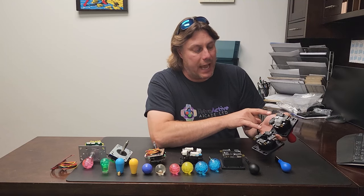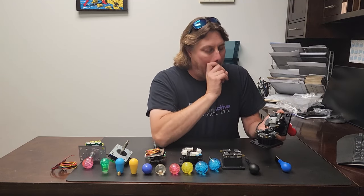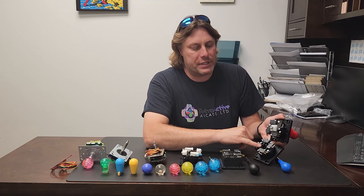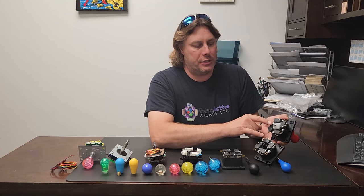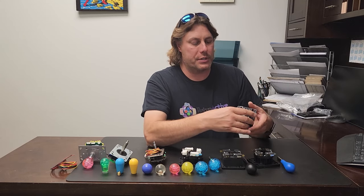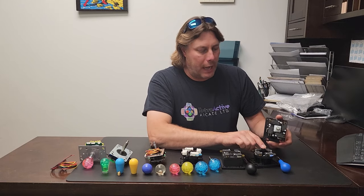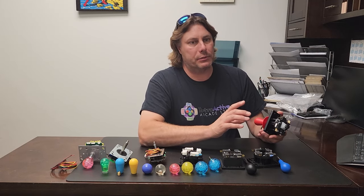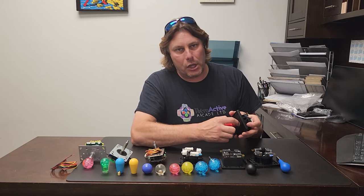The only difference is the actuator itself. This one's made out of nylon, which keeps it a little bit quieter. And the Suzo Happ one just has a molded black plastic one. One doesn't really last longer than another. It changes the sound of your actual movement on your stick. So it keeps it quite quiet. This one will be a little bit louder, right? That's pretty much one of the only differences. Inside, you also have a nylon insert there.